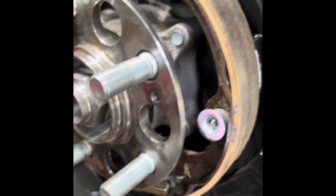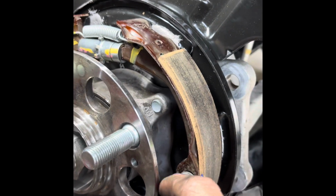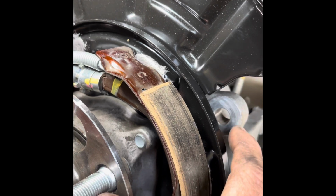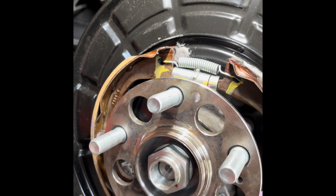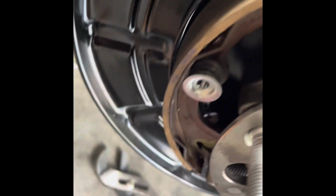Okay, folks, so here's what I did. Put in the rear bearing. Very simply, I pushed it in, got it kind of flush, made sure the CV joint was sticking through enough where I can get a nut on it. Okie dokie. The 4 bearing bolts are torqued down to 133 foot-pounds. That's fun to do under your car.